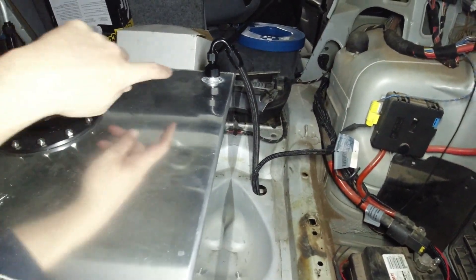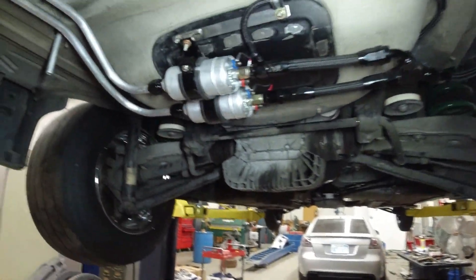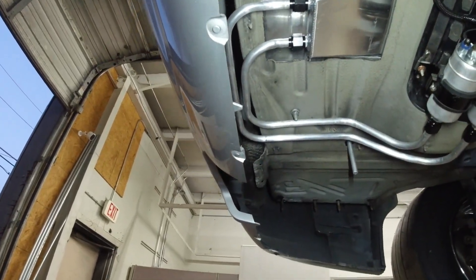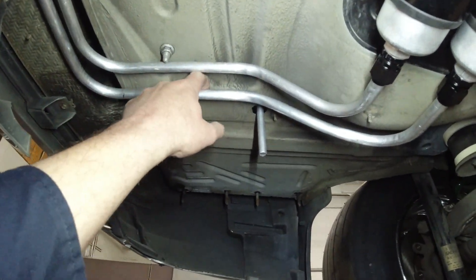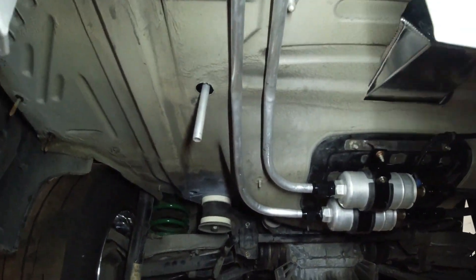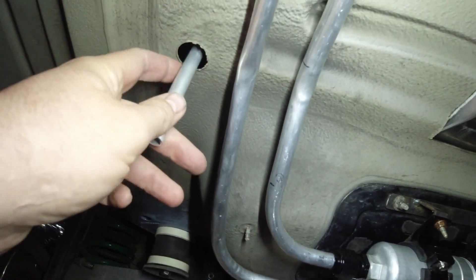The return line is going down there on the side, and there's the lines all bent up — just aluminum 5/8, two dash-10. I think I'm going to make a bracket here to hold these two together just so they don't wiggle. There's the vent coming out — probably going to make a bracket for that too, probably just get a grommet so it'll be nice and tight.